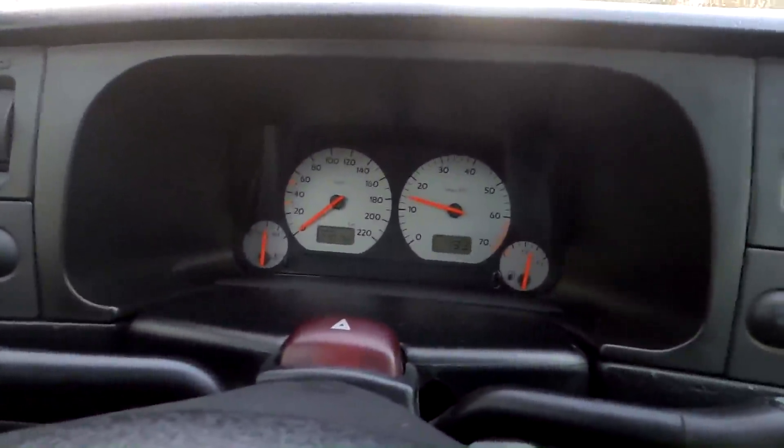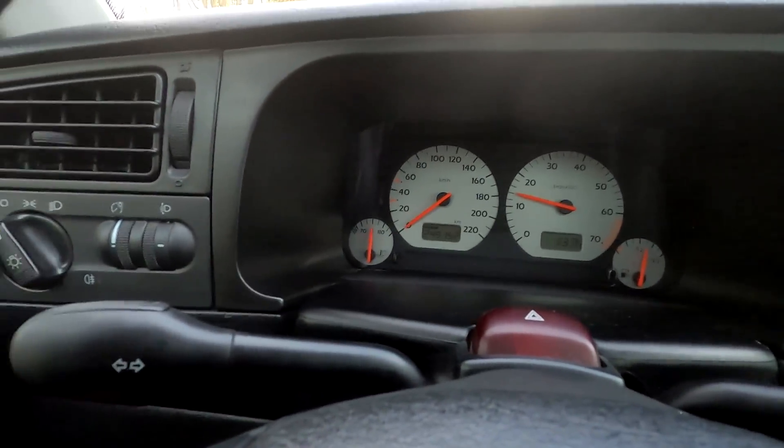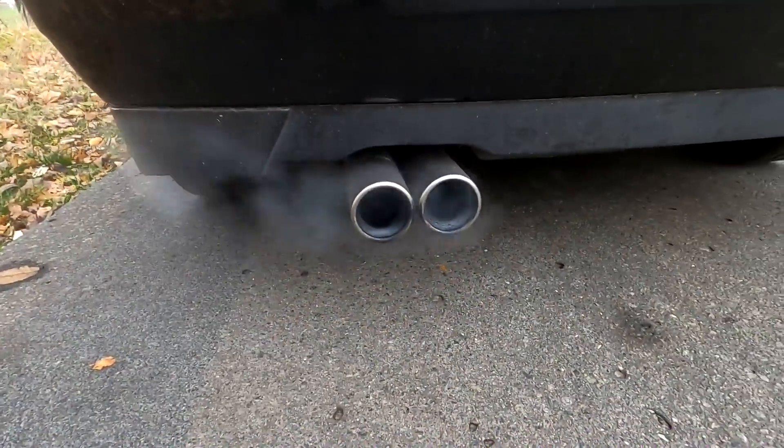Is this a never-ending story, this car? I don't know. I would have loved to tell you something different — that it runs fine. I mean, it does run, but it's puffing out the back like it's burning water. I have no luck with this car. What should I do now? What would you do? Write it in the comments. Sell it again? Or take another look at the valve stem seals? I don't really feel like it anymore. So — pulling over briefly. The idle speed is way too high right now. The engine is warm now. You can see how much it's smoking — that's definitely too much. It's drawing in water somewhere. I could be sick. It also rattles oddly and accelerates roughly — well, sometimes yes, sometimes no.